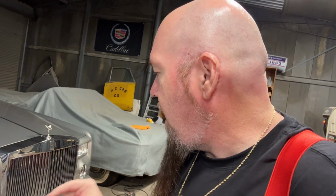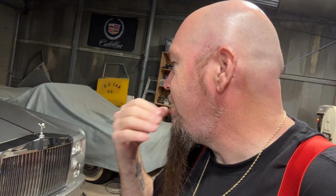And then if I were to pop the hood, there's these small, about the size of your finger, small coolant lines that run to it. So you have two encapsulated 180 amp alternators that are in this cavity together. And that cavity is cooled with the engine coolant. So as it comes out of the radiator, it goes through those alternators first and then through the engine or something. But these cars actually run very, very cool.